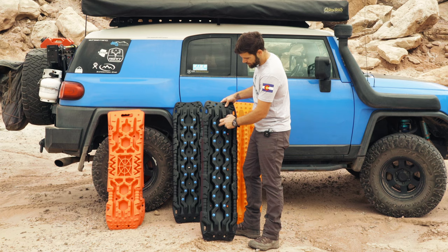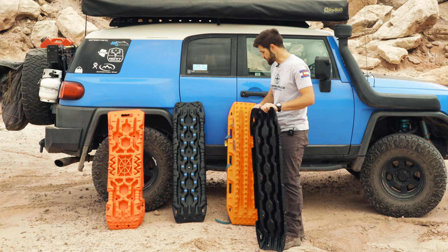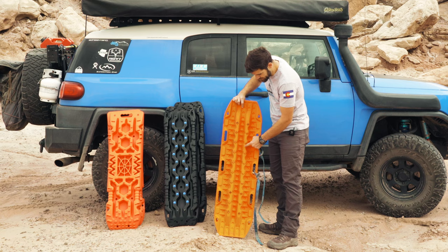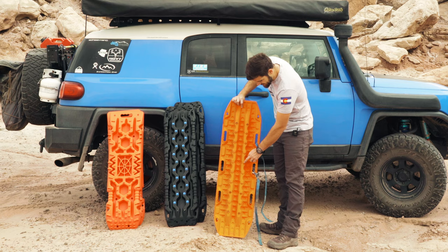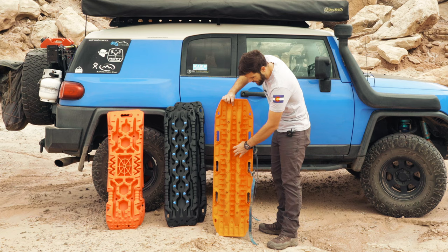At the same time, it's kind of brilliant because when this gets sunk into the mud, it won't have a vacuum effect like the Max Tracks will. Whenever you try to pull one of these out of mud, it's sucked down because there's no air underneath — it's like a suction cup. The bottom of the Max Tracks has these lines and lugs, which will catch into pretty much everything and give it footing. Whether pressure is going vertically or horizontally, it has traction because of all these ribs.